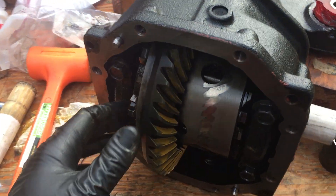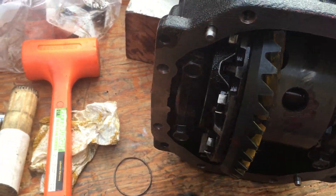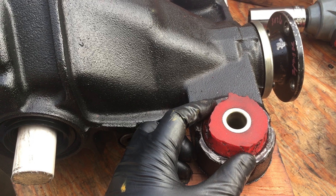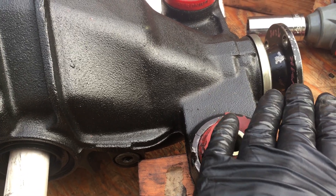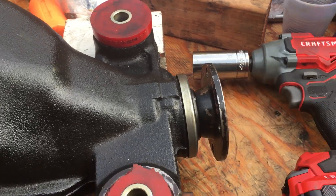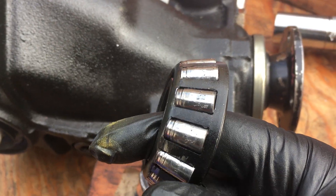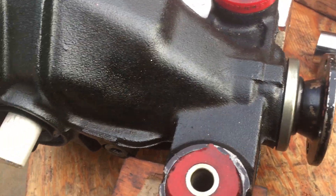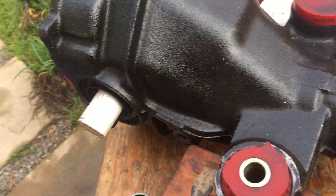I've just completed the rebuild of this M85 LSD 3.7-to-1 gear ratio differential from an IS-300. What had happened was that whoever changed it probably followed a video guide where a hammer was involved, with it sitting on the ground. You do not want to expose this part to any lateral mechanical stress — it is meant only to rotate. One dent became this mess, eventually creating so much metal shavings that the seal was chopped up and leaking. The side ones had some damage as well, and there was so much metal coming out I was worried everything would be completely toast.